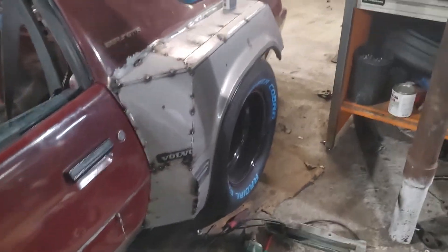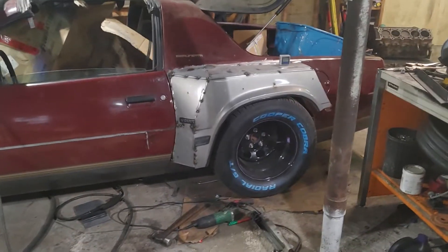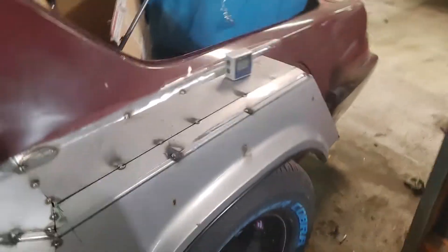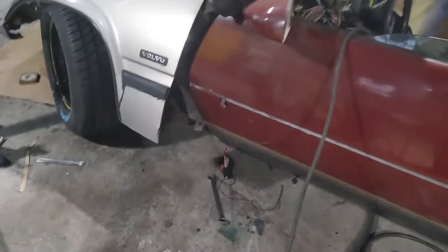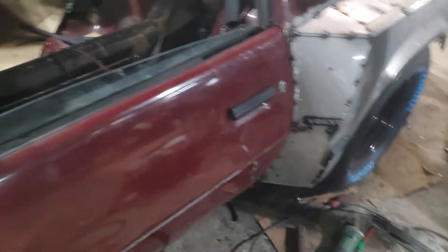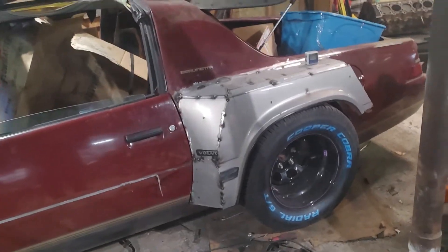So we cut it apart — the passenger side — and put it on the driver's side of this car to kind of make something that would fit. This is made out of completely one of those fenders, so we're really not too committed on this design. The only bits of steel I used were that and that piece, just to extend it out. We cut across this seam line here and just overlapped it on that seam line, which means it tapers back because I have them reversed — I need this to kick down farther on the front than the back, which is the opposite on front fenders because front fenders are meant to go on the front and not the back.